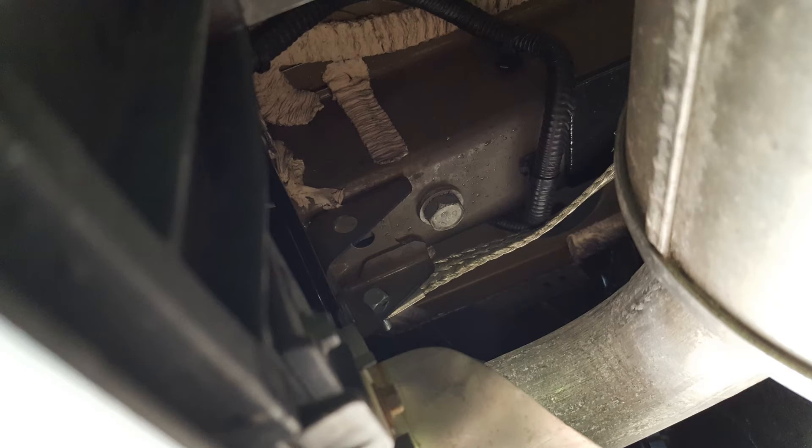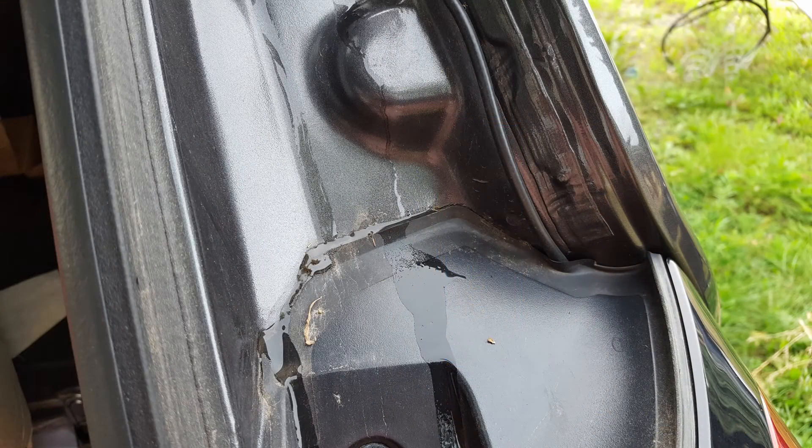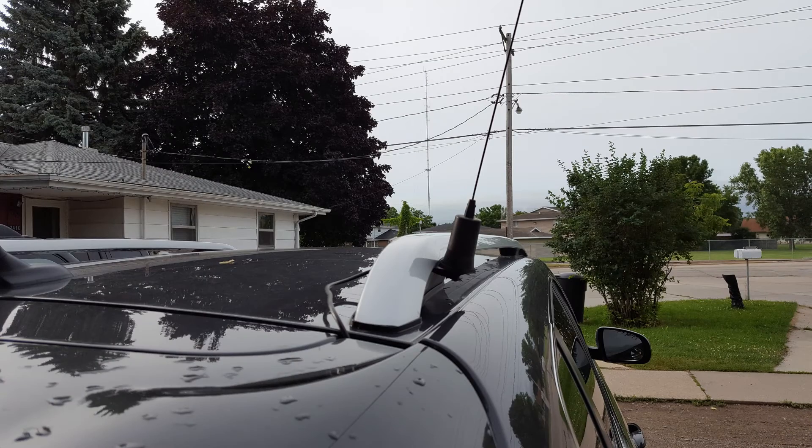I also fixed the ground strap at a secondary location on the frame, thus binding the entire frame. For VHF and UHF, I run a Kenwood V7A, affixed to the side of the console on the passenger side. The wire for that runs up through the taillight assembly into the antenna, which is a Larson 270, mounted on the luggage rack.